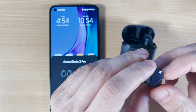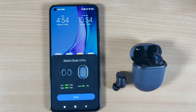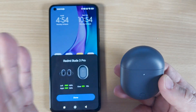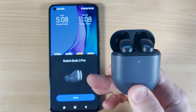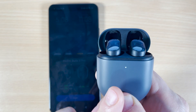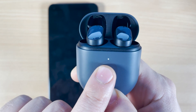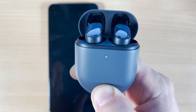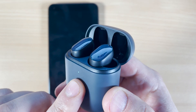The first thing you have to do if you see any problem with the buds: put both buds on the case, then close or open the case — no problem at all. Touch and hold the reset button for 10 seconds. You'll see a flashing light, which means it is resetting. When you see a continuous light, that means we are done with resetting. You can release the button — the buds are now reset and searching for pairing.